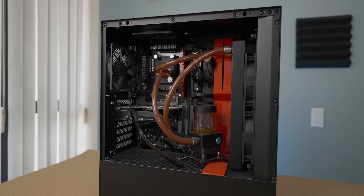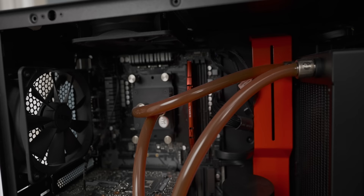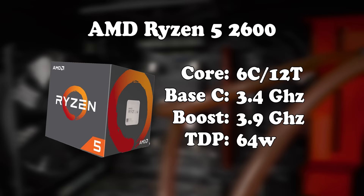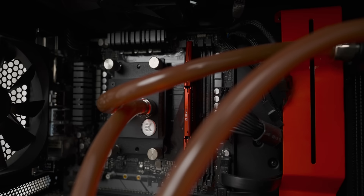Now the first thing that you'll notice on the inside here if you're a massive nerd like I am is the fact that there's only one RAM stick in here. At this point I feel like I'm in some ridiculous fever dream where I'm being haunted by systems that only have incorrect RAM configurations in them. And the thing that makes it worse is the fact that under this gratuitous open loop there's a Ryzen 5 2600, and Ryzen CPUs are the thing in the world that hates single channel RAM more than I do. I feel like at this point these PC buy videos are just turning into David gets angry at RAM.